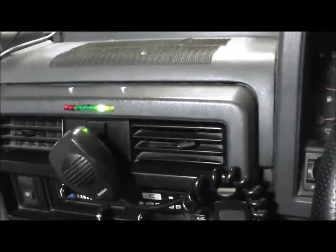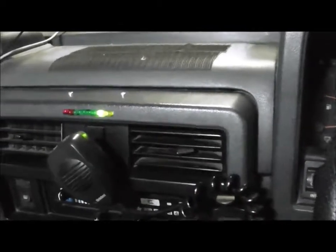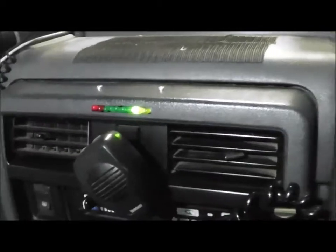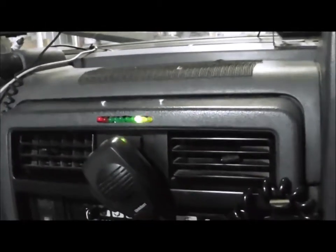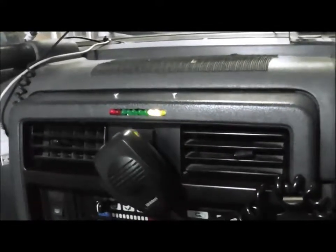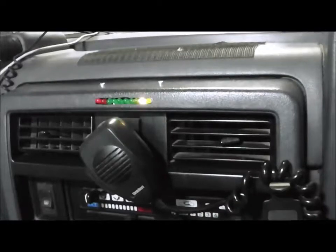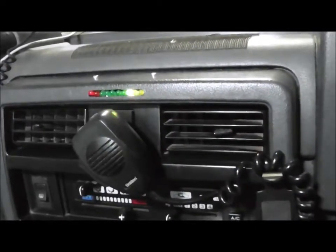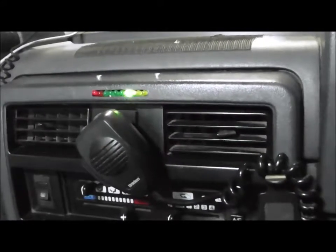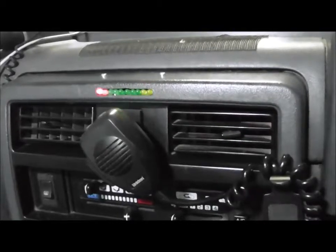Here's the thing working — that's on petrol at idle. It should be staying within the green region. Some cars will idle on the rich end, but a GQ Patrol will tend to idle around there or coast depending on engine heat. On petrol the oxygen sensor should be flickering at least 15 times a minute — more like 20. If it's not doing that, either you have a carburettor or there's something wrong with the oxygen sensor or your fuel system.